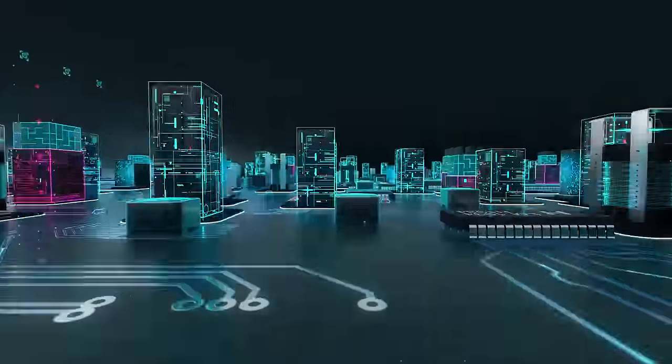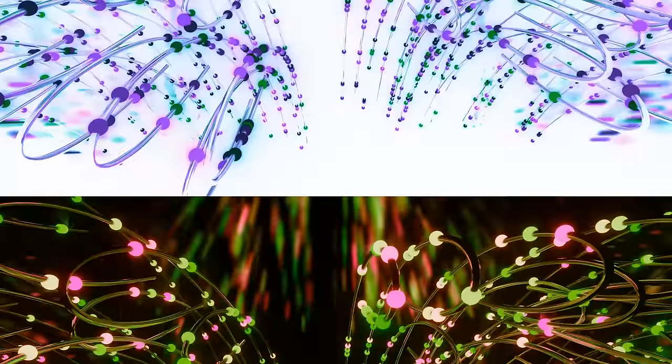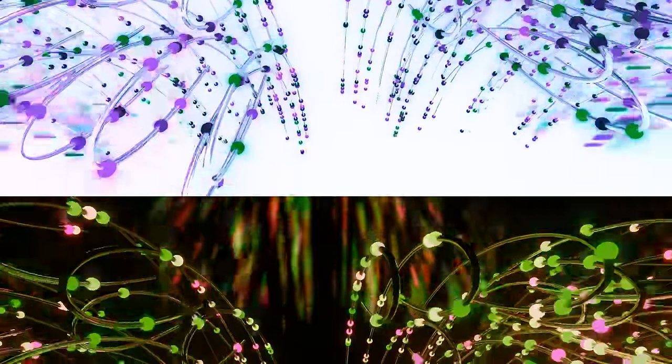Without having to connect directly to the computer — imagine if every single sensor and light in every part of your car had to be connected directly to the computer with a wire. Your car would basically just be one huge mass of wire. So that's where CAN bus comes in. Every single one of these devices hooks up to the CAN bus system, and then the CAN bus connects to the computer. One wire carries data, the other wire carries the inverted version of that data, making a very redundant, robust system.